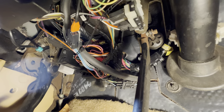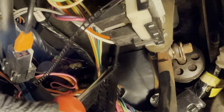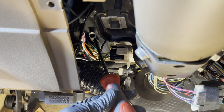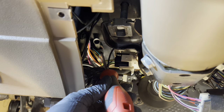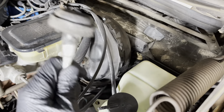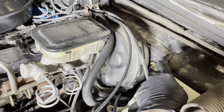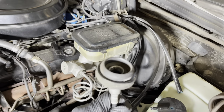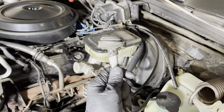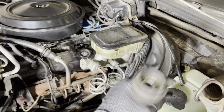Here's an awkward view, but I'm underneath the steering column. You can see to the right of my screen — I'm going to point the screwdriver right there. That's where the speedometer cable comes down and tucks behind the firewall. Right back there is the speedometer head as it was at the instrument cluster, and I've fished it all the way through to basically the point where it's going to go through the firewall. We got it out here — I had to pull on it quite a bit. There's the insulation and that's the opening for the speedometer cable to go through. Here is the cable at the end that was at the instrument cluster, and this is the rubber seal or grommet covering that hole.